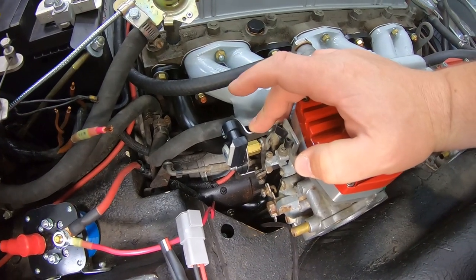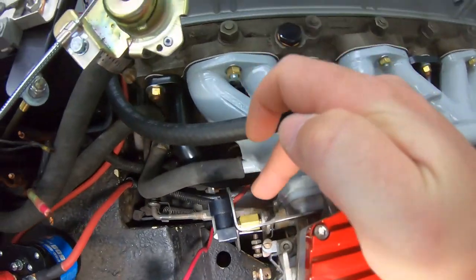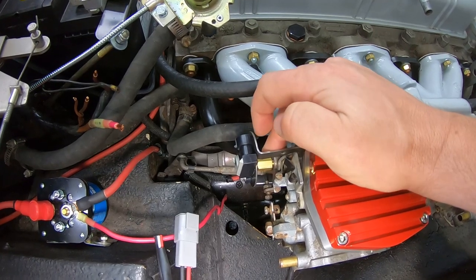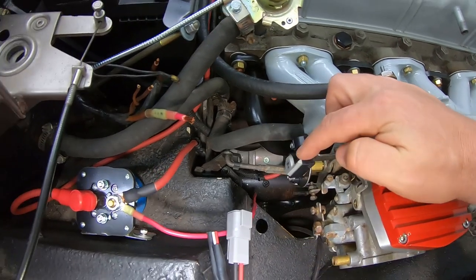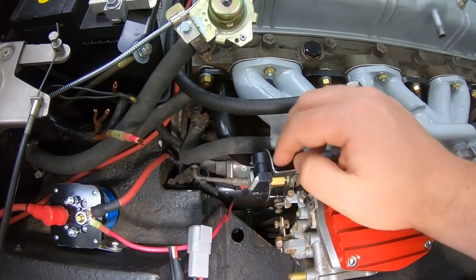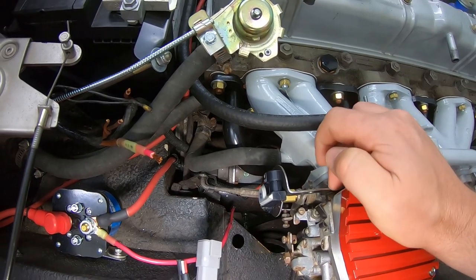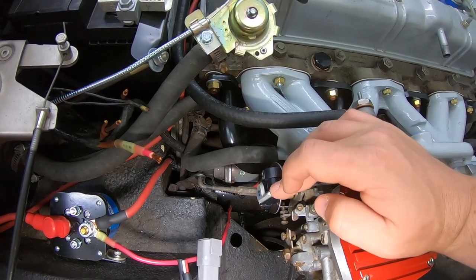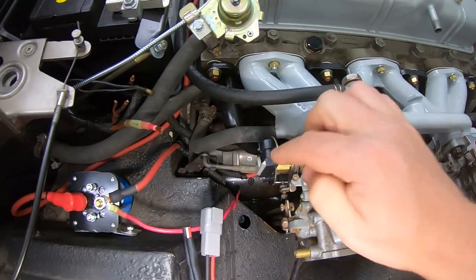Here you can see we have the TPS now installed. You have to take the end nut off of the linkage shaft between the carburetors, put this brass fitting in place which screws on like a nut, is locked in place by an Allen screw, and then has a key at the end which engages your TPS. You have to thread this on to the right position to engage the TPS at the right position, and you may need to bend the supplied bracket to get everything aligned just right. It reuses the outermost two carburetor bolts, and you need to make sure those won't cause the bracket to slip as you get everything lined up.